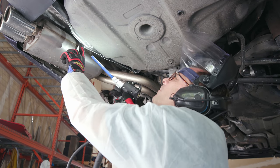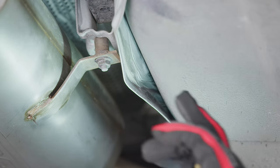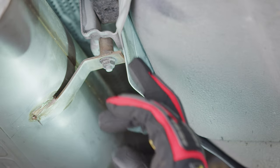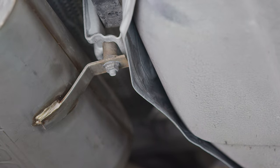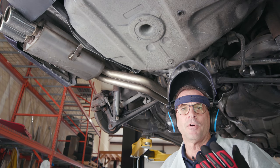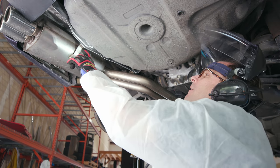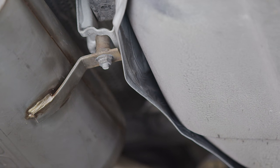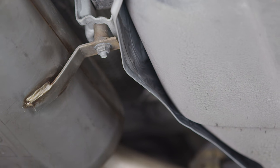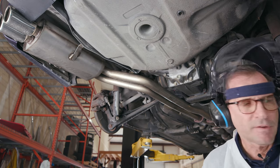If you look right here, this is the lowest pressure that I have. I still have impressions from 0.3 and 22 pounds. It's just like aluminum foil you use in the kitchen. I can't not put little dents in that. This is a classic case where you just have to watch. I can't really go any further with that. That'll have to be handwork if they want it. So I'm going back up. We'll go over some big stuff.